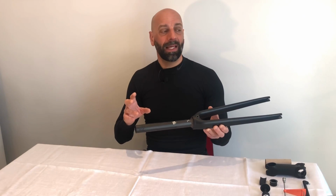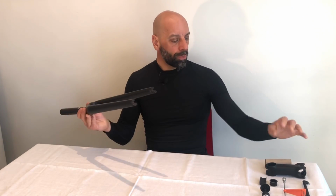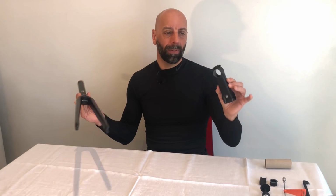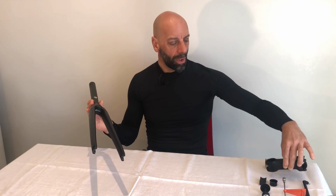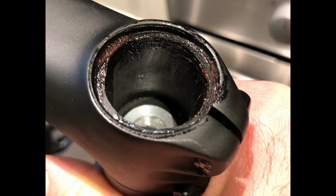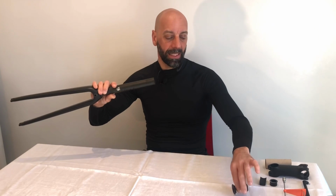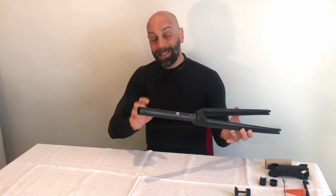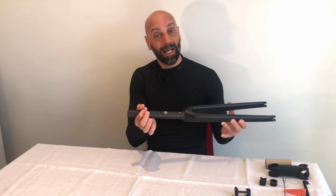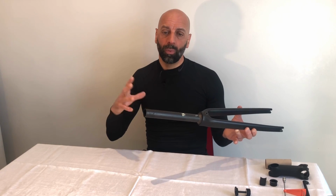With Canyon, there is a discrepancy from all the other manufacturers because Canyon forks don't come with a compression plug. If you buy normal Canyon bikes with the classic stem combination and remove the top cap, you will find there's a hollow space where the clamp of the stem is positioned and nothing else to really reinforce the interior of your steerer tube. This is because Canyon has an oversized steerer, 1 1/4 inch compared to 1 1/8 inch.